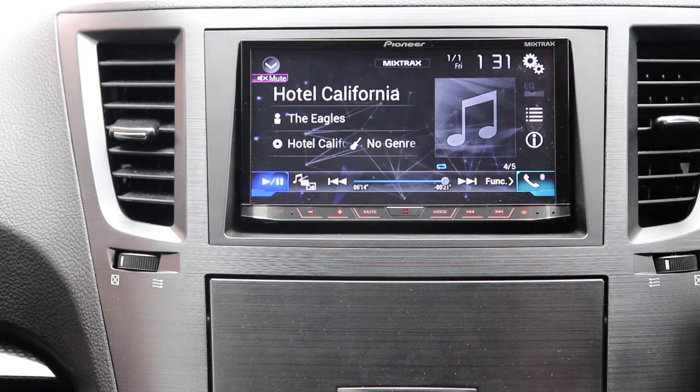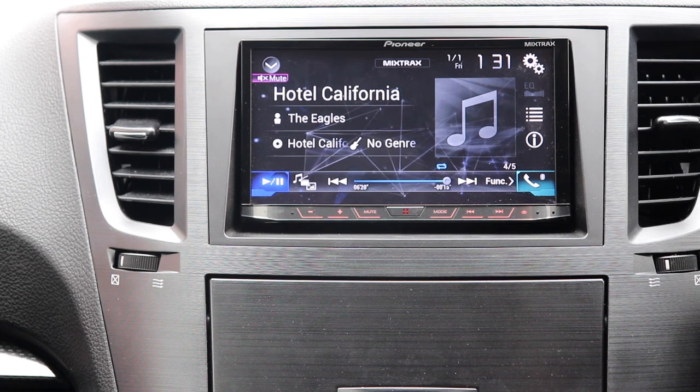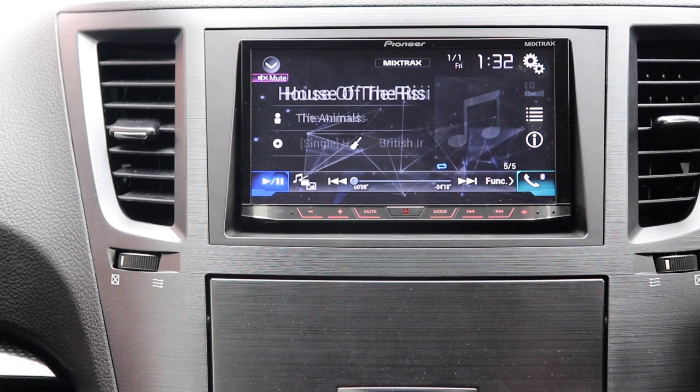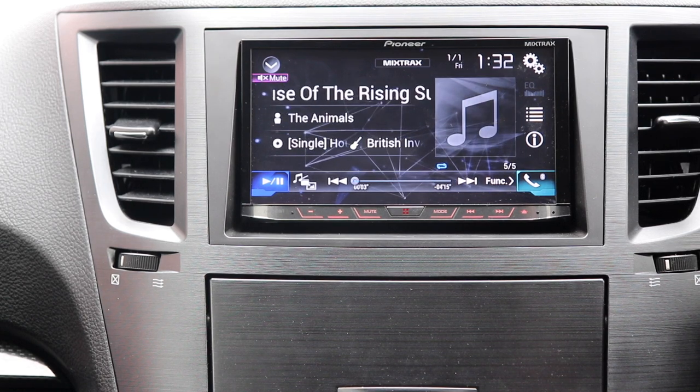So when the sensors pick up something in front of the car, first it waits until you're quite close to something, like about half a meter or less than a meter, and then it starts doing the slow chime, and it will only give you the slow chime but no image until you get closer to something, where it gives you the solid chime and then it starts displaying the image. And then if you go further out of range there, the image will stay on. Also, it's worth noting that even when in reverse, the front sensors work.